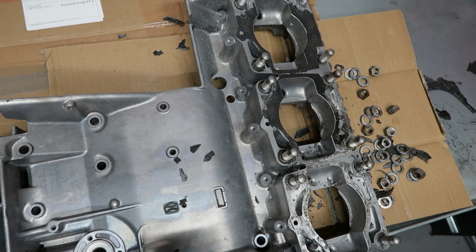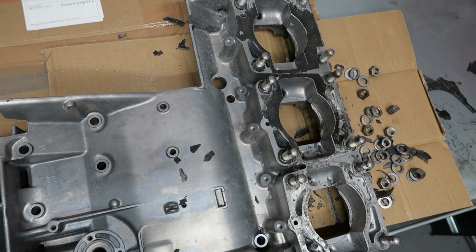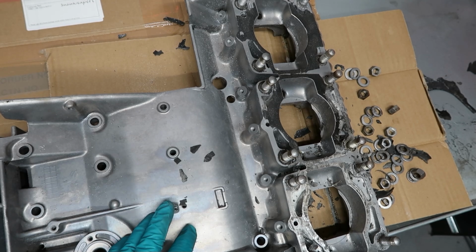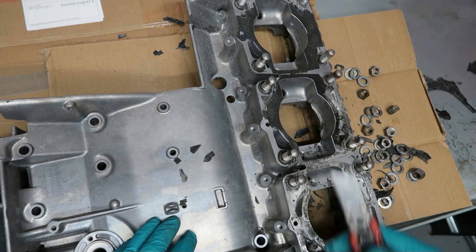I think molecular should be okay, but copper slip I use, and it doesn't affect the integrity of the gasket itself, in no way it does. But it does mean that if you assemble the engine, oh crumbs, this doesn't feel quite right, and you go to take it apart again, if you haven't used the anti-seize compound, then you end up tearing the gasket and needing a new gasket set again, which is obviously a bit of a bind. Plus you're doing a favour for the guy, well, the lady I should say, that's going to take their thing apart again in 10, 15, 20 years time, because it'll come apart so much easier, so you don't have to do all this crap.